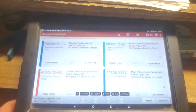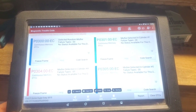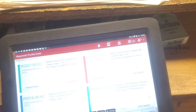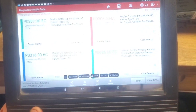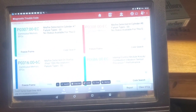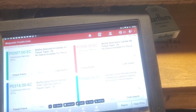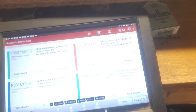Here are our codes: we've got a misfire on cylinders 1, 5, 4, 7, and 8. We've also got misfire detected on startup, and the knock sensor is going crazy with a P06B6 combustion vibration sensor code — basically the knock sensor saying something is very wrong.